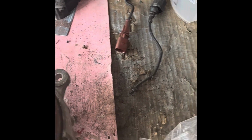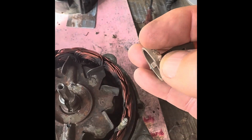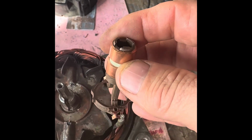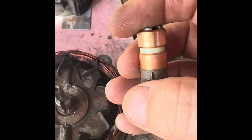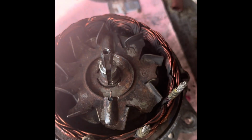They've arrived. Here I've got my new slip rings and brushes. So what we'll do is take out the slip ring. I take that out there. Well, they're the new ones. You see they've got those bits there, so you could just clamp up on those wires. I might drop a bit of solder on there just to make sure. But first of all, I'm just going to check that there's no problems, check that the rings have continuity, and then we'll put this on. Okay, they're good. I've just checked the continuity, so they're all nice and good.